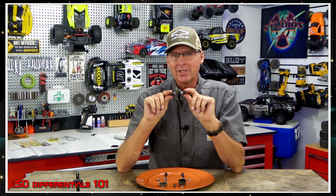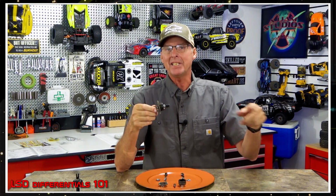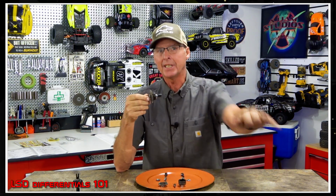All right. That's where your oil comes into play. Because if he's got fairly stiff oil in, his front end's going to come up in the air. He's going to have to backpedal the throttle to try and keep the front end down because you can't be fast on your rear wheels. You can't. You have to have the front end down to put the power to it, right? Okay, a thinner fluid will allow you to crouch a little, bleed off some power to the front, but keep the front end down because it bleeds the power off. So you can keep your front end down and stay on the throttle and outrun them.